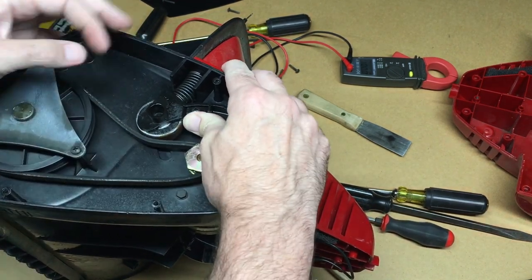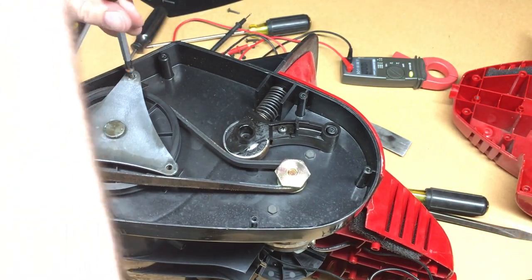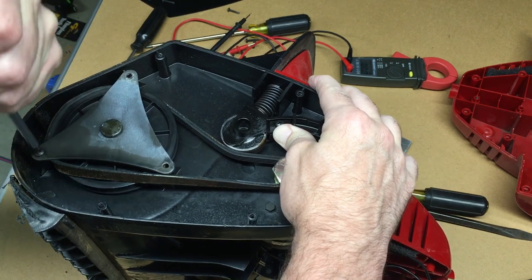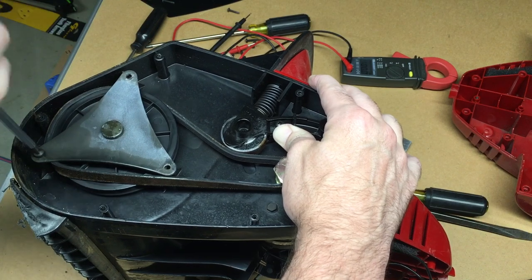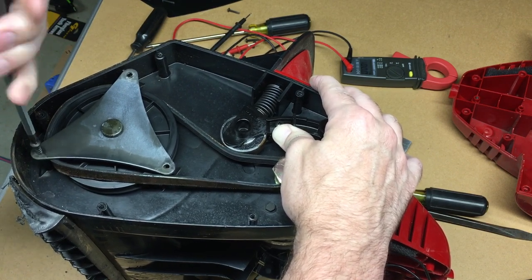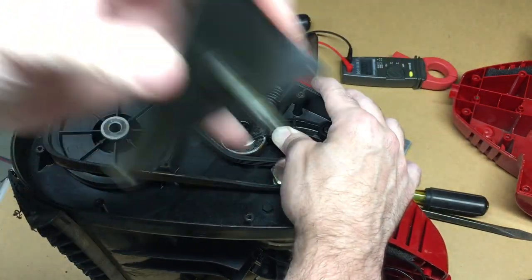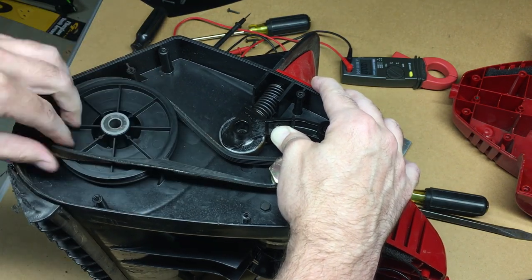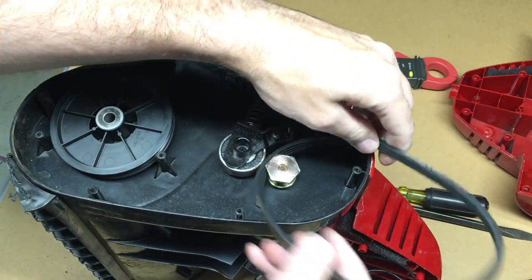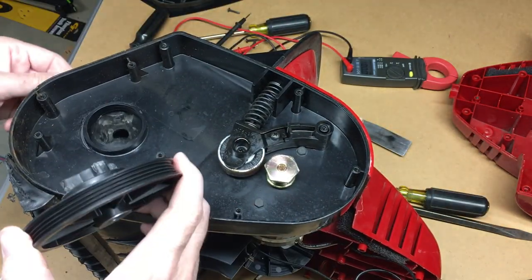I'll take this belt off if I can get it off. This is probably under tension, so I've got to be careful — it could fly up and hit my thumb. What I'll do is release the tension here a little bit. That's not moving a lot so hopefully it's not under too much tension. It would probably be a good idea to wear some thick leather gloves. Okay, we've got the belt off and here's the pulley. Looks like there's a bushing in there and it has a plastic interface between this and the paddle.